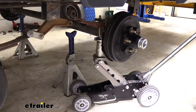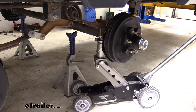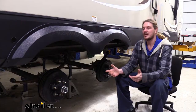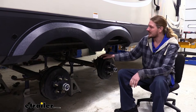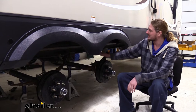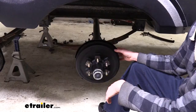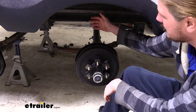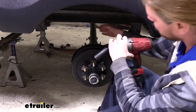You can also use your screwdriver to finish punching the pins out. Lower your axle down onto the jack stands, then repeat the same process on the rear axle. Once both axles are completely free, move them to one side — use an extra set of hands to help slide them since they are heavy and you don't want to tip the jack stands. This gives you easier access to remove our leaf springs, because otherwise the frame will be right above and it'll be difficult to get tools in.